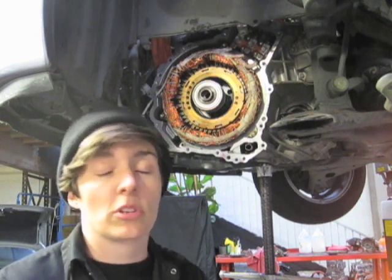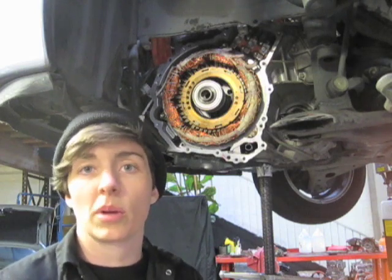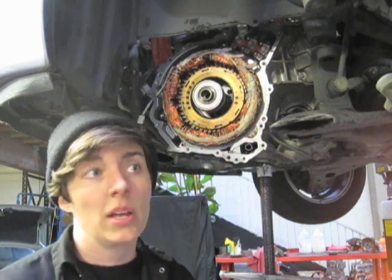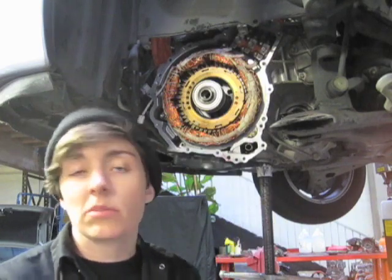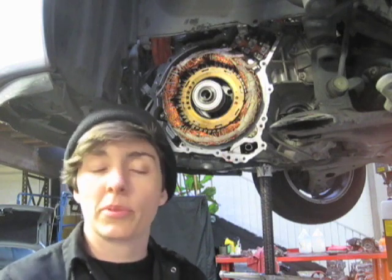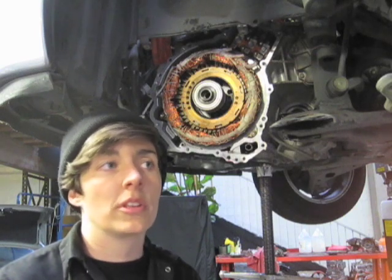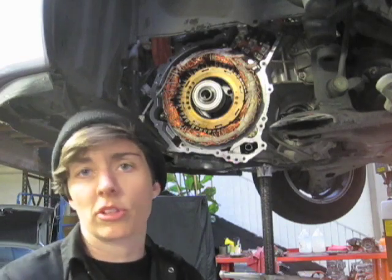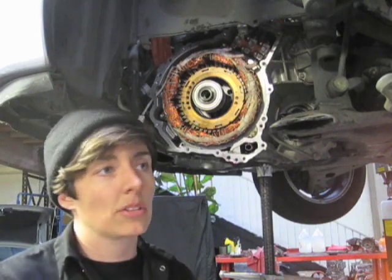There's a lot of discussion — a lot of lip service — about fluid changes, and why we obviously advocate for fluid changes on a regular basis every 30,000 miles. Just because you're changing the fluid doesn't necessarily mean that you're not going to have this problem. It gives you better odds, but we've seen failures with cars that have been religious about their fluid changes. So obviously you want to subscribe to preventative maintenance to give yourself the best chance. But the discussion about having to drop the pan and wipe it out and sterilize the transmission — if you don't, it's going to prematurely kill your transmission — is a bunch of mumbo jumbo.